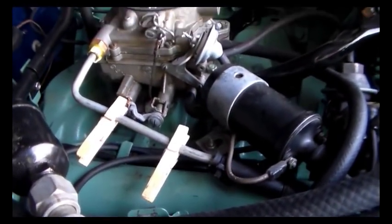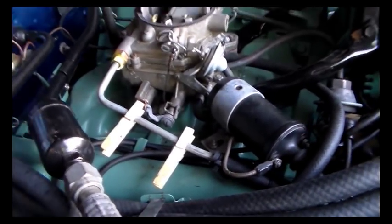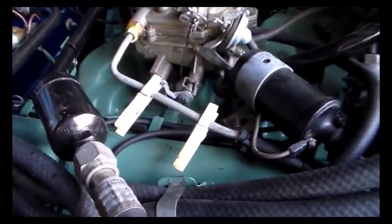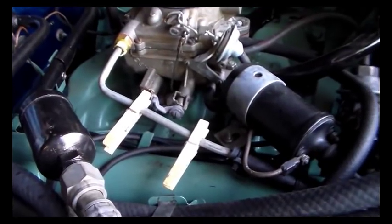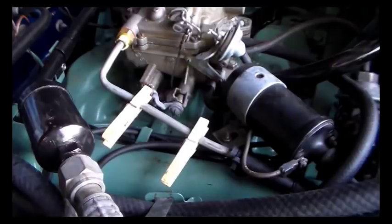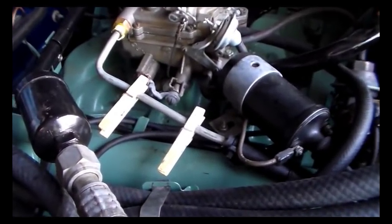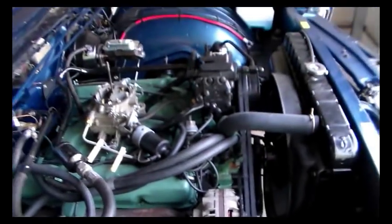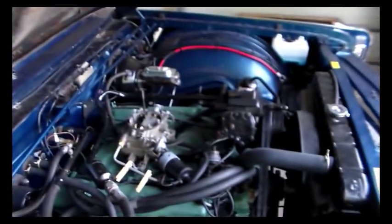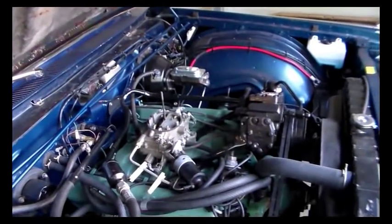And you know you wanted to see that. You know you did. Just go ahead and admit it now. You wanted to see somebody do that. That's an old-time supposed remedy for vapor lock, is to put clothespins on the fuel line. It's supposed to be like a heat sink, kind of draw the heat away. I don't know. But it's period correct, though, either way. You're really not going to see it because that huge old air cleaner is on top of all that. But we'll see. Looks funny anyway, doesn't it?